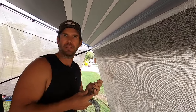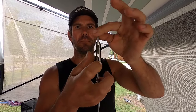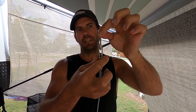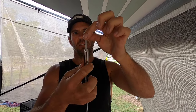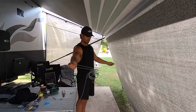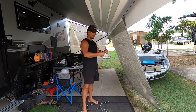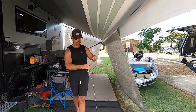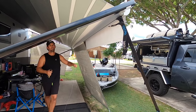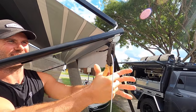Hook it up and walk the wire out to measure the right length. Good tip: extend your turnbuckle all the way out before you start, so you've got full travel left for adjustment when you want to tighten it later. Put it all the way out, hook it up on the eye bolt, then walk out the wire and untangle it. Once it's extended all the way out, grab your pliers, run it just a bit past the other eye bolt, then chop it off.